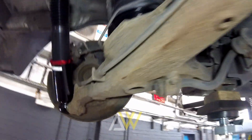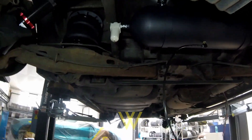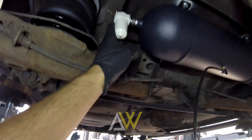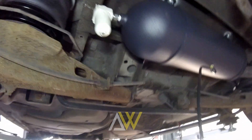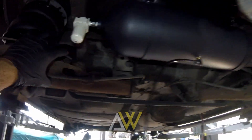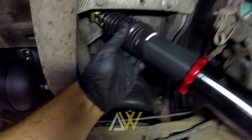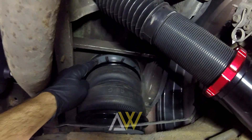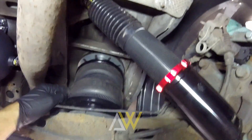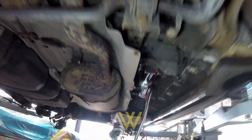Still need to change that elbow to go to the top. The big change here is that the rear struts and airbags are in. From what I can tell I'll probably get away with a 90-degree elbow on the end of the water trap and that shouldn't foul the rear arm. Nothing on this side is going to foul. The strut has been fitted both top and bottom using the factory bolts and new top mounts - this is what we were waiting for yesterday, which is why we didn't fit the airbags yesterday. The spacers at the bottom are included in the kit.